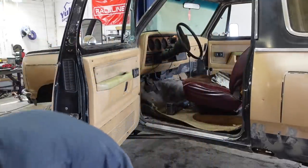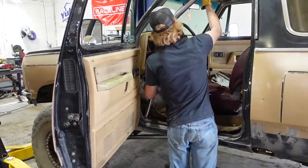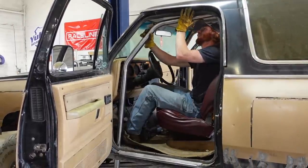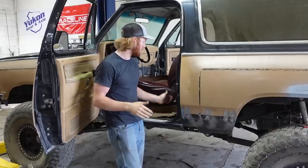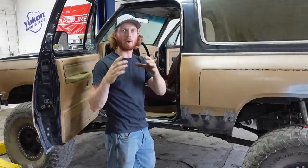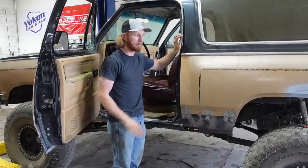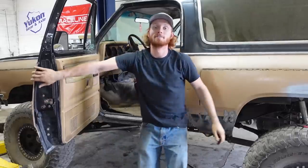Alright, got it — now we can finally see if this will go in. We need to get rid of some of this rocker panel to put in the style of rock slider I want — the kind that actually gets welded to the body. We'll use some 2x6 rectangle tubing I've got on the floor to make our sliders. But before we get started on the slider, we have to cut away the metal we don't need anymore.